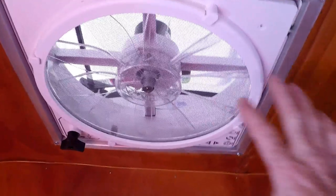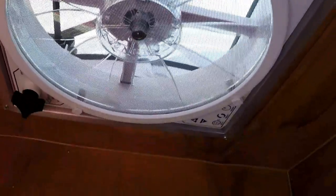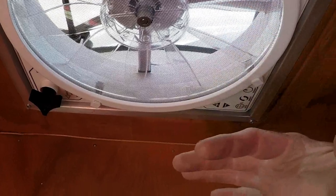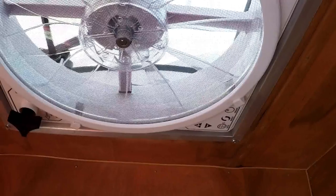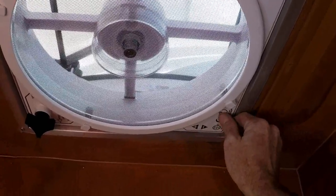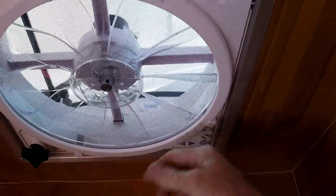Up here I added a new vent - this is a MaxAir vent fan. When it's closed it looks just like a normal vent, but when you crank it open, the vent lid itself is a MaxAir vent cover, so you don't need to put a separate dome cover on top. They're really useful because if it's raining and it gets stuffy, you can keep the vent open without rain coming in. I think this is probably better than a Fantastic Fan. You can change the fan direction and speed, and unlike a Fantastic Fan you just rotate the four blades down - pull the vent screen down, wash it off, without worrying about breaking the plastic.